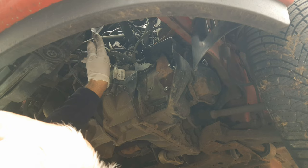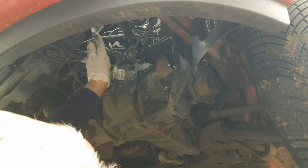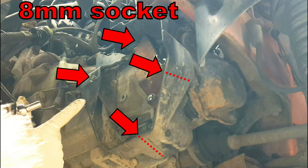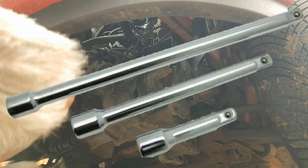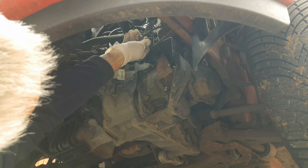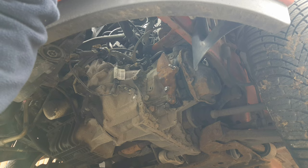The same on the top one — it's a little awkward and difficult with your fingers. Now with your 8mm socket undo the four screws that hold the rear side of the plastic cover to the gearbox. The four screws are positioned as I'm showing you with these red arrows. This front one is easy to get at, but you will need an extension bar to get at this one, this one, and this one just to one side. I found it easier to get the screws out with the 8mm socket on a screwdriver handle.